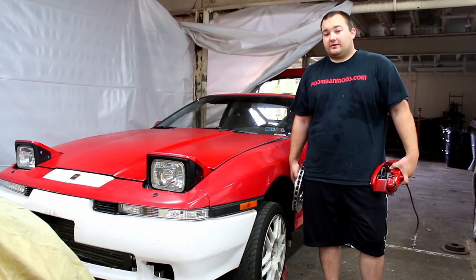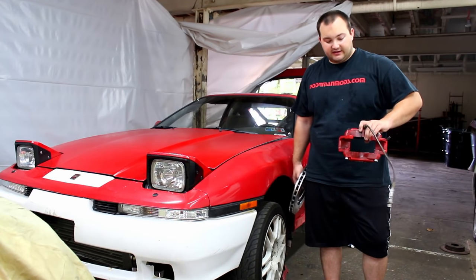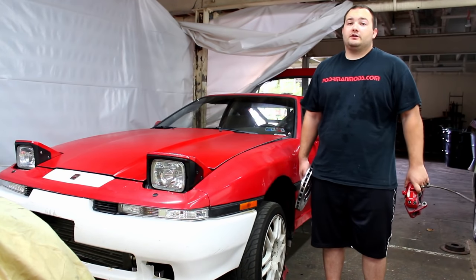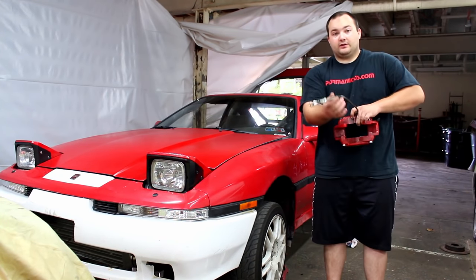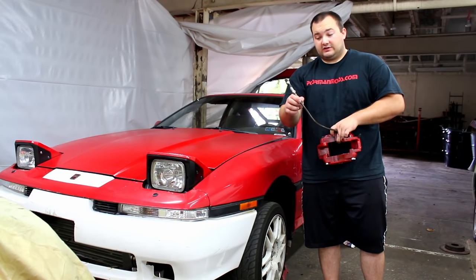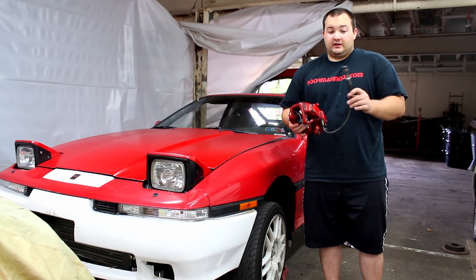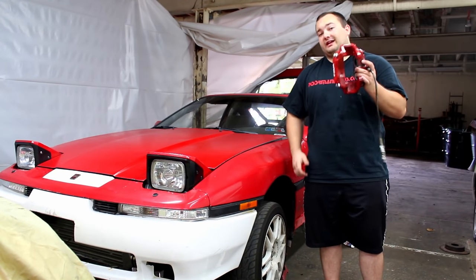So this is quite a substantial upgrade. But I will take credit for finding out that, at least for the brake calipers I got, the Mercedes brake hoses were different — they were the bubble flare instead of inverted flare, which I don't think would have sealed properly. But if you remember on Tony's AE86 Resto Mod series, we upgraded his brakes and he actually gave me his old braided hoses. These are stainless steel braided brake lines off of a 1986 Toyota Corolla GTS, and I have them installed on one side and they work just fine. So for this upgrade it's going to be 1986 Corolla GTS brake hoses, 2001 Mercedes S500 brake calipers, and 350Z rotors.